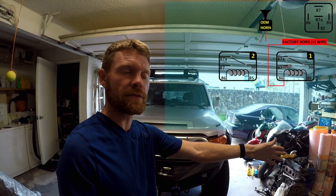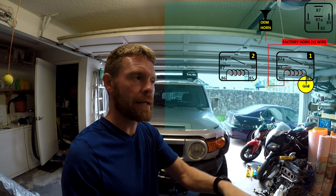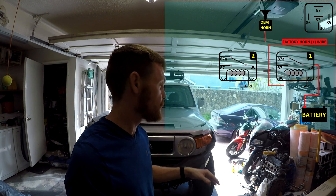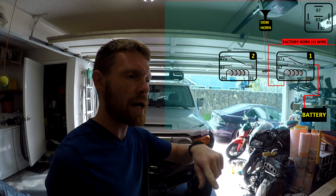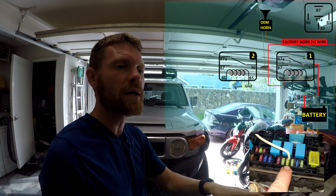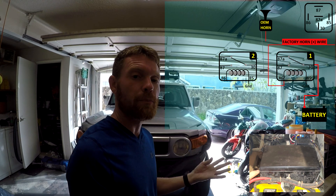You need two relays: the primary relay and the secondary relay. The primary relay gets a signal directly from the horn — I cut the factory wiring at the horn about two inches away and ran it into pin 86, because the factory horn is a positive signal and pin 86 is the positive side of the electromagnetic coil. Pin 85 is the negative side and goes to ground on both relays. Pin 30 on the primary relay connects directly to the under-hood fuse box over the driver's side tire, tapped into a blank always-on fuse location.